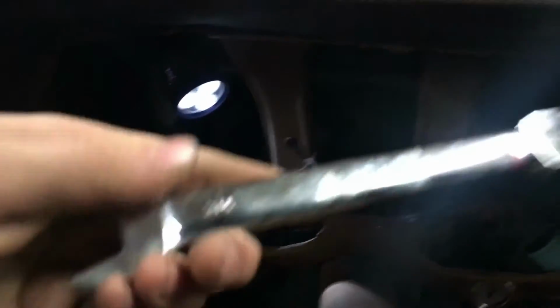So you're going to want to loosen that off. So I can get the screwdriver, or the flashlight, so you can get that in there. So you just basically want to unscrew that nut, and then you can pull it away from the cluster. And now that one, you're going to want to use an open box end wrench for. I used the nice heavy duty one, the 3/4. Pretty nice size. So I used that and I got that off.